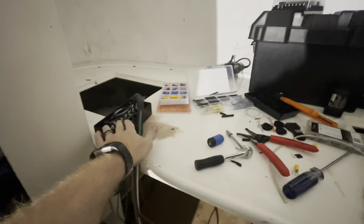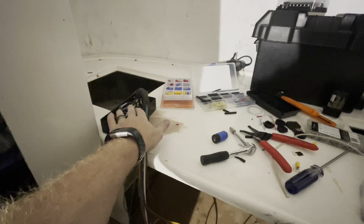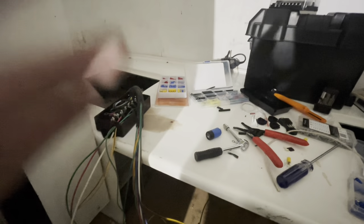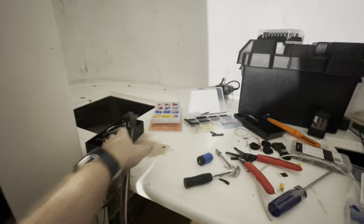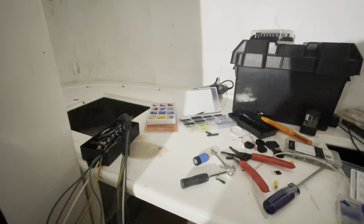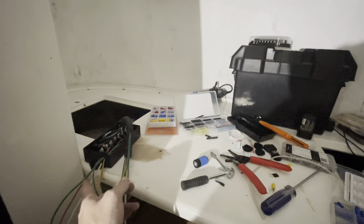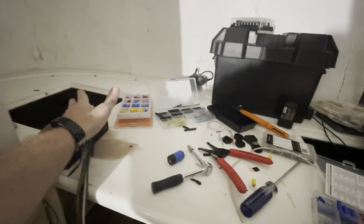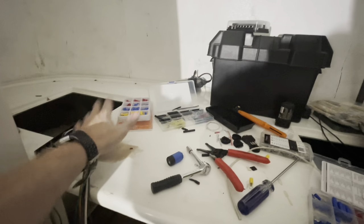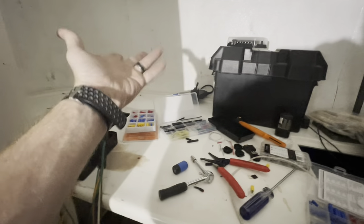The good thing about this is not all seven-ways are alike, as I said earlier. I think Scamp just loves to put different ways of doing things — no big loss. You just move these cables if they don't match exactly what a blinker is for a seven-way on your tow rig. I did this on the other Scamp I had, because I can't remember if it was the brown or the red or whatever that has blinkers different. I think the red comes off the seven-way as brakes, or something like that.